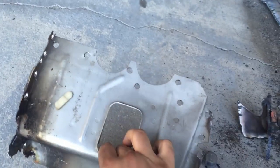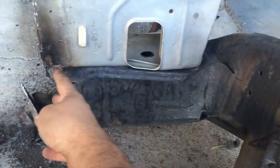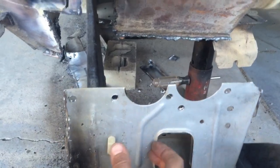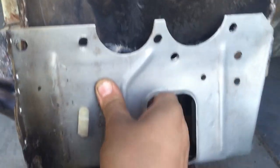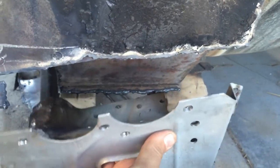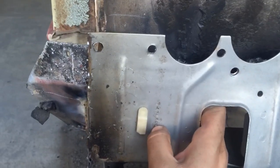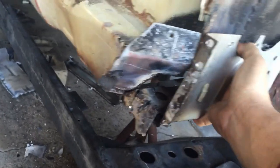This is the mount that was on the front of the Crown Vic — I just finished drilling out all the spot welds on this part right here. It sits about this high because it's sitting on those pads. I should have had this out sooner for reference. My lines from eyeballing it are pretty much spot on from my measurements, so it's probably going to go right here. The outside of that almost matches up. This might just need shaved back right here to be even with the firewall, and the inside is going to hit so it'll need trimming. There's still a lot of rough cutting before things get finalized, but things are kind of working how it's been planned.